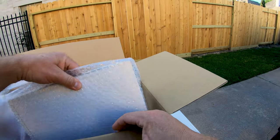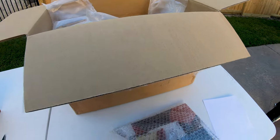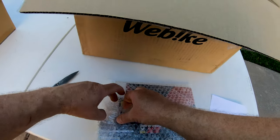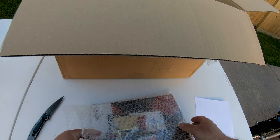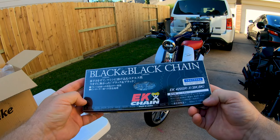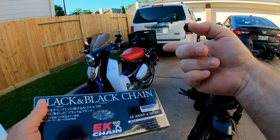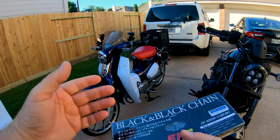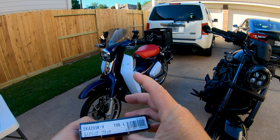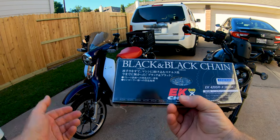That's heavy — I know what that is. No, that's not quite what I thought it was. There should be another heavy one in there. I got a chain for my Super Cub that I will put on before I embark on my cross-country trip. This is an x-ring chain. The chains that come on these little bikes are just standard chains — they're not x-ring or o-ring. Presumably cheaper, lower rolling resistance, whatever, but that also means more maintenance. X-ring chains are less maintenance, so I'm gonna put that on there.